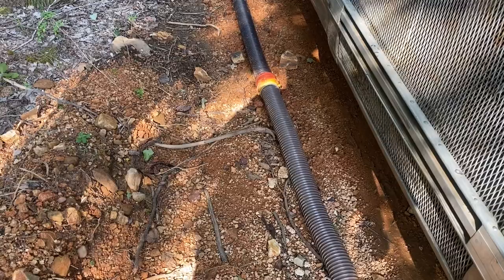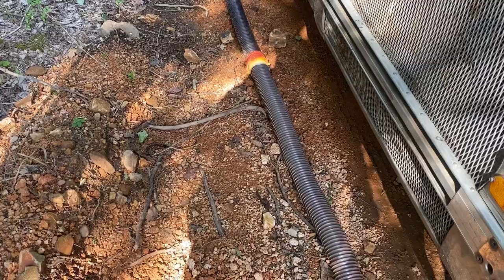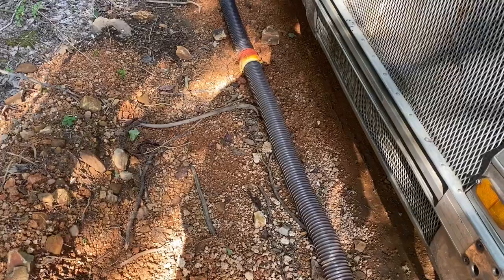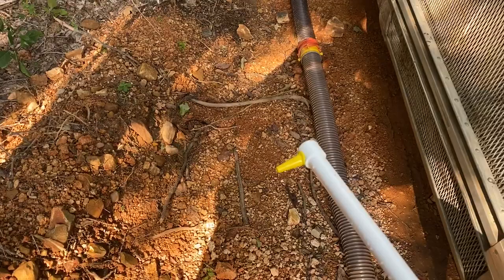I know nobody likes to talk about the poopy side of RV stuff, but we had what they call a poo pyramid. The bottom of the toilet, you know, because it's a straight down shot, you kind of get a pile of stuff there, and it ended up plugging up, backing up the pipe inside where the black tank wasn't full, but it was just kind of sealed off by what had happened underneath of the toilet. But I used this thing here. It's a big long stick with a high pressure nozzle on the end, and you stick it down there and turn the water on, make sure it's all the way down in the tank, and it really blasted everything away